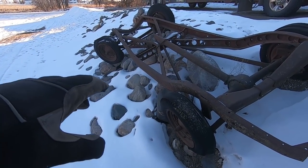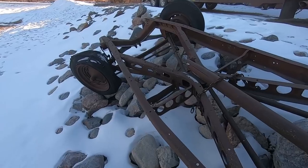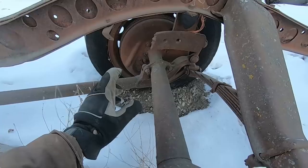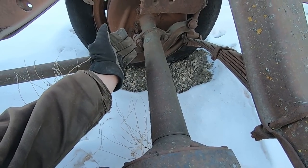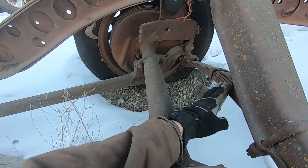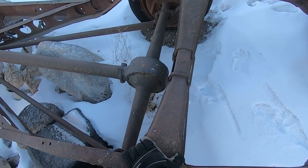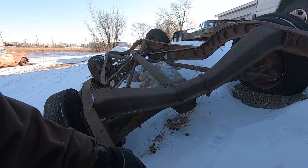So this is a 36 frame. You can see the cross member — the legs are about equal length in the back as they are on the front. It's got these supports that go between the frame rail and the cross member, and how tight it gets right around the drive shaft in the middle. 33s and 34s are quite a bit wider. The rear wishbones on 35 and 36 bolt to the axle tube a little ways from the end of the axle tube housing, and they've got the spring mount built into them. The spring mount is behind the axle as opposed to being straight over it like a Model A. The 35 to 40 cross members are pretty much straight across, but wider on the outside and tapered down in the middle, with a pretty big drop to them — probably the biggest of all these frames.